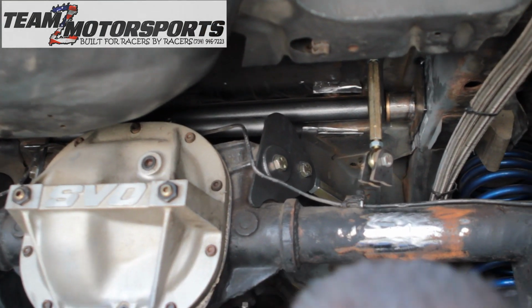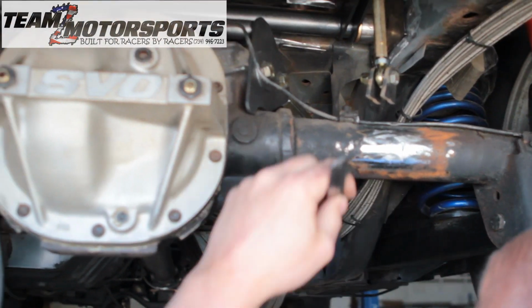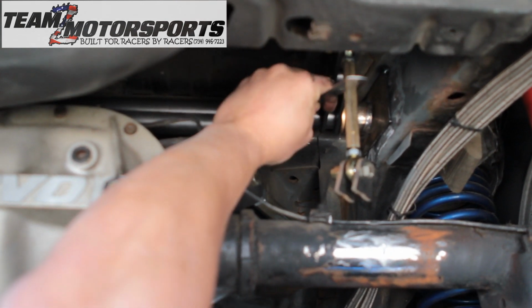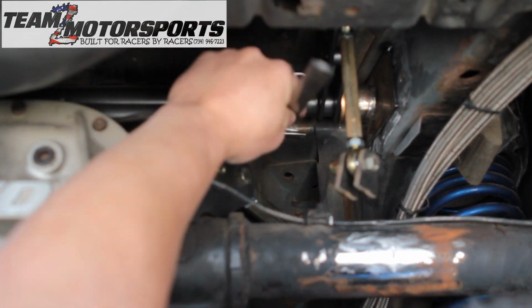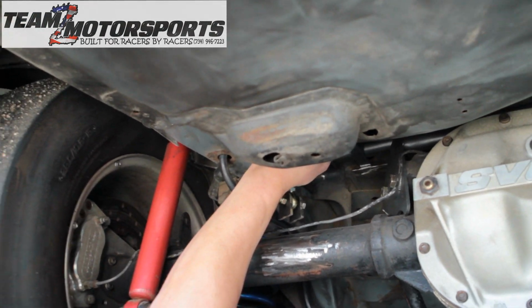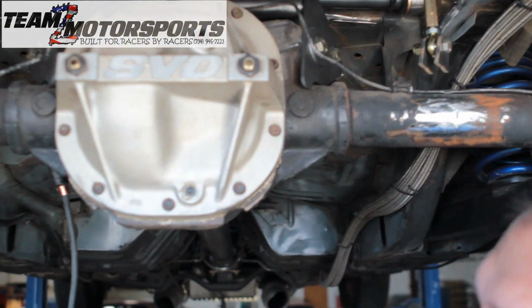Because, you know, if you get it a little bit crooked and you start welding it, it could bind up on your end. Got you. So you always want to make sure everything's in straight. And then you just check your measurements again from the bulkhead. We got 1 3/4 still. And 1 3/4. It's good. So she's ready to burn in. Yep. Willie's gonna make his paycheck today. Yes, he is. Cool. Let's go.